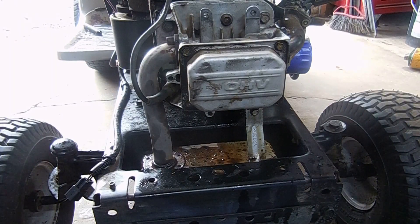I got it all back together. I got the valve cover on and I set the valve clearance to six thousandths on both intake and exhaust. I'm not sure if that's right — that was the first thing I read. This is my own personal mower so I'm not too concerned about it; if they start to get noisy I'll adjust them. That pretty much walks you through what to do to change a head gasket. I do have to put the cover and the air filter back on, which I'm not going to show you because it's pretty simple.